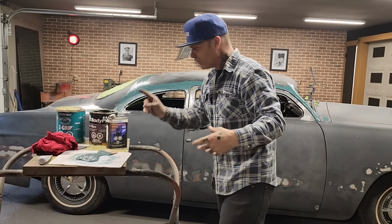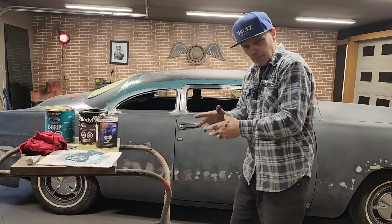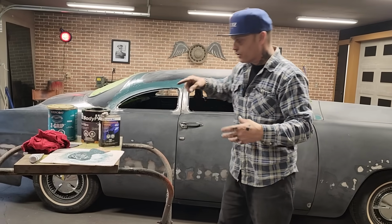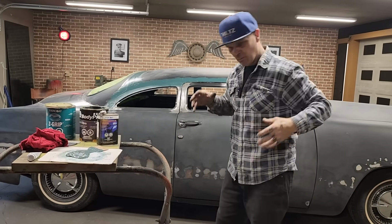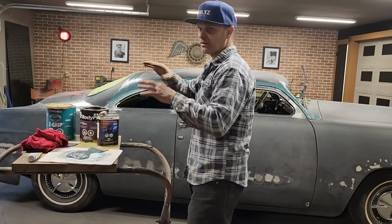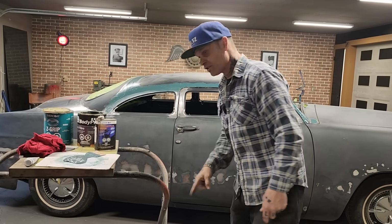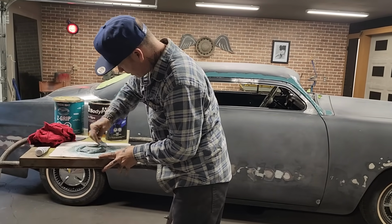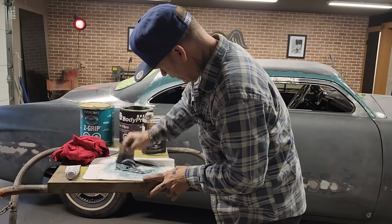And then I proceeded to mix up some fiberglass and put it in around where the railing had been broke. I connected it back, got it back together pretty good, sturdy. Then I took my fiberglass and put it all in where the wood was, in the shape that it went to the railing. I fiberglassed it, I body filled it, I sanded it, and I painted it. I put carpet down the steps. It looked like a million dollars. It looked really nice, where it did not before, when it was broken.